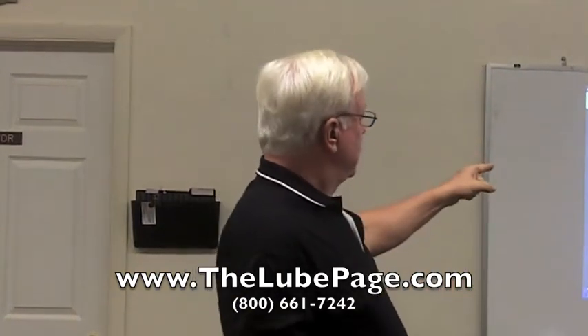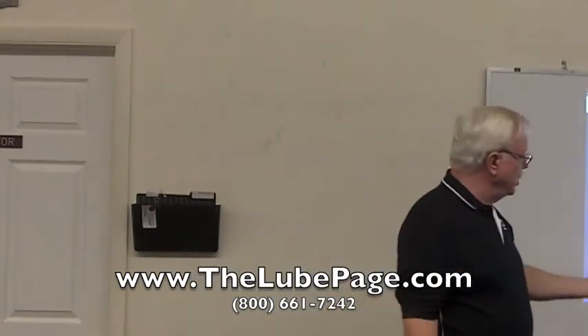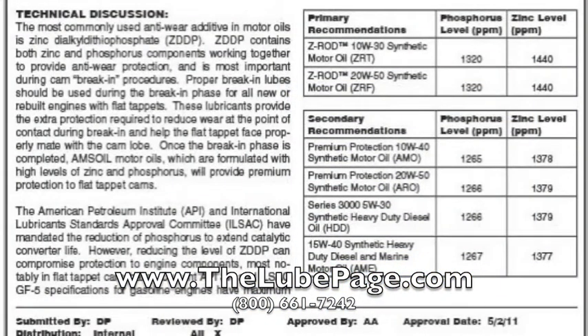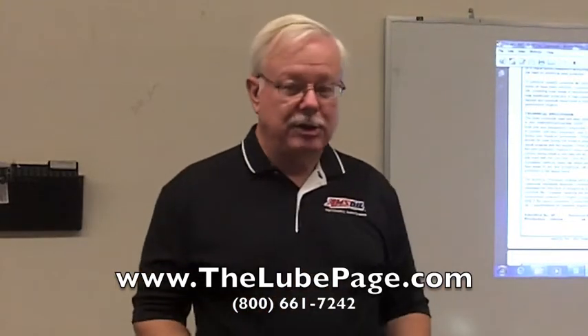Z-Rod is one of our oils, but looking at our original AMSOIL oils — the 10W-40, 20W-50, and the diesel oils 15W-40 and 5W-30 — they're almost just as high, with 1,200 to 1,300 ppm in each of those categories. So we always told people: when automotive oils were changing and you couldn't find anything else for your motorcycle, buy a good heavy-duty diesel oil, because our 15W-40 was a heavy-duty diesel oil.